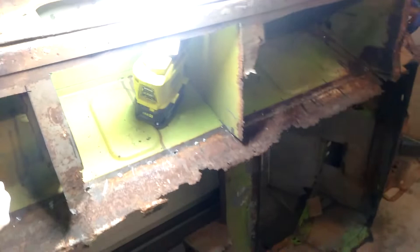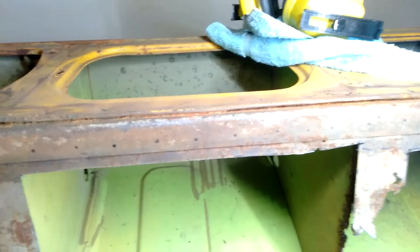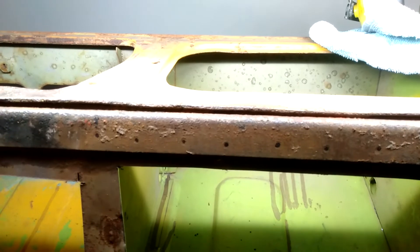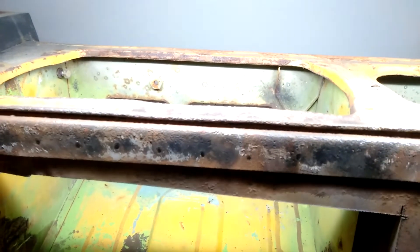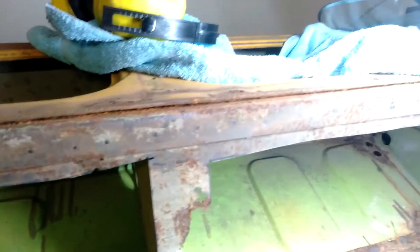I need to remove the floor for the right hand side pannier. In order to do that I've got to mark the spot welds and then drill from the other side, because the floor is underneath that panel and I don't want holes in that. One little trick I found - if you get your torch or light source at the right angle, where I put the black dots are the spot welds, but you wouldn't know that just looking. But if you get the light at the right angle you can see craters where each of the spot welds are. Some show up better than others. Don't forget these cars were built by people doing these spot welds by hand, so there will be variation.